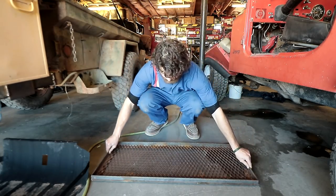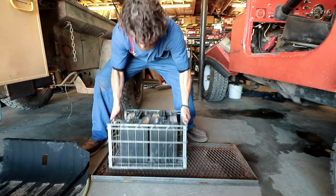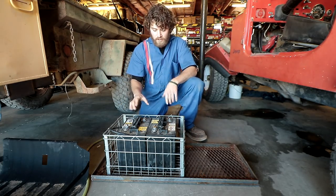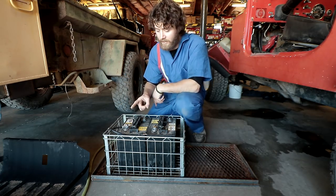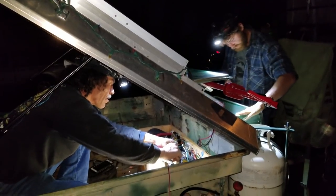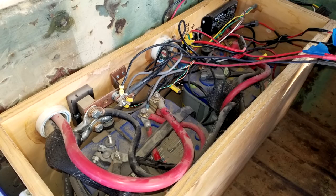Here's the plan. To that platform I will be mounting this metal crate with two golf cart batteries, six volt, wired together to create a 12 volt battery. Right before the Baja trip we went on recently, Izzy's father and I replaced the four Optima blue top batteries that were nine years old and failing, and replaced them with these golf cart batteries.